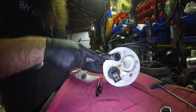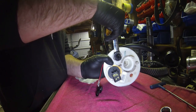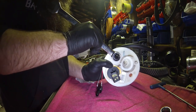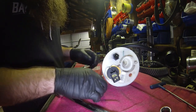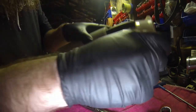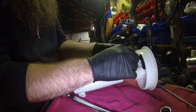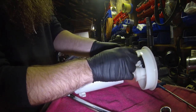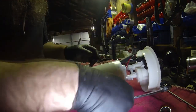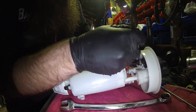And it's a 7/8, at least the ones I have are. If you get a different dash 6 bulkhead, it may be a different thread size. I can't promise you on that one. Some of the ones I have here are 7/8. So you get your bulkhead fitting in. You add your dash 6 to barb fitting. That one, the Vibrant, is an 11/16.